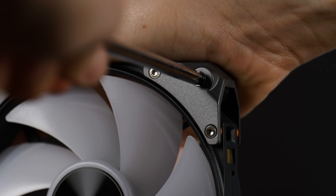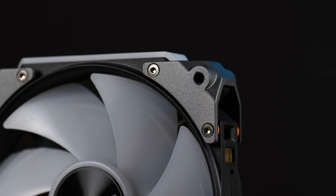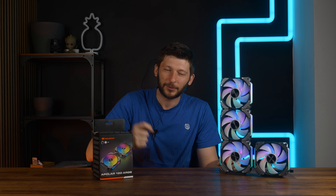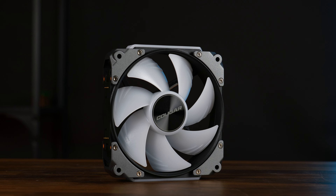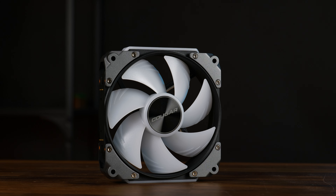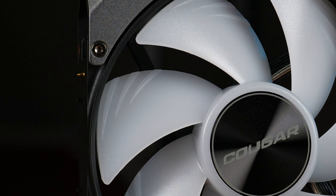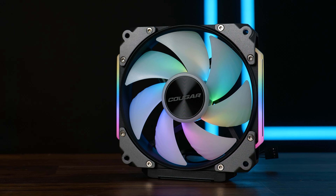Something else you might notice: these mounting holes are really small. The corners look like metal, but it's just regular plastic and you get the same screws as always. In my opinion, because these holes look slightly smaller than the usual corner hole, screwing in a case screw once does more damage to this fan than to any other fan. And if you have issues getting out these hooks using a metal tool, you will very quickly do damage to these corners — these corners do not like metal.